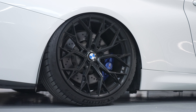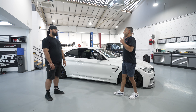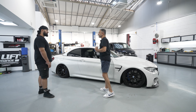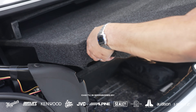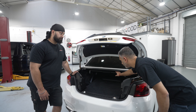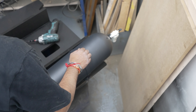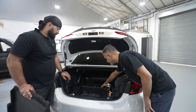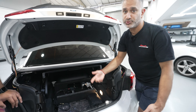I think this is sitting really well — all four wheels are tucking. It's running about 40 PSI at normal drive height at the front and about 100 PSI at the back. The only reason it's 100 is because on these they use a mini bellow, and on top of that because it's a hard-top convertible it is a significant amount of weight at the back, so it's just to counter that.